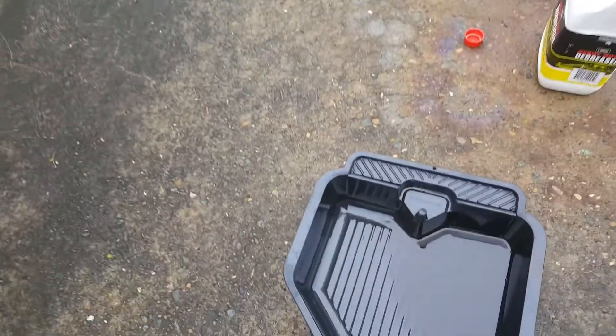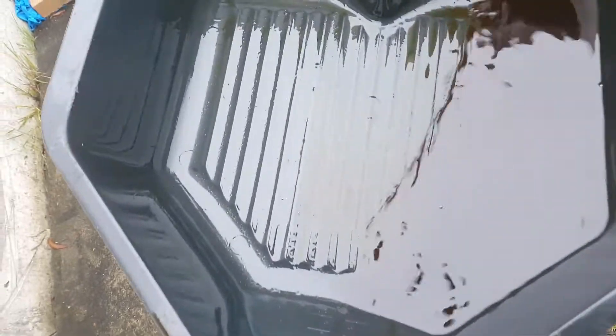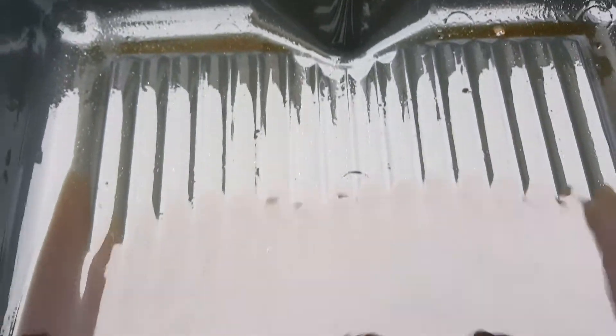When you get a new vehicle you can find out the condition of the engine. What you don't want to see is metallic filings - that's not a good sign. You can put a bit of fuel in, swish it around, and when you bring it back you may be able to see metal filings. It could just be old oil that hasn't had a proper oil change.